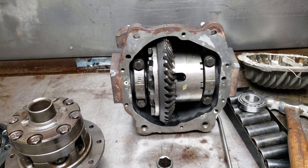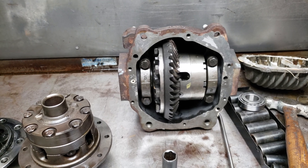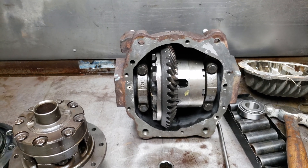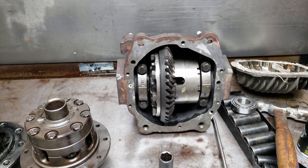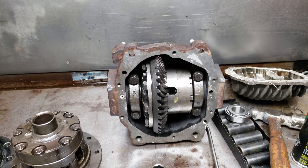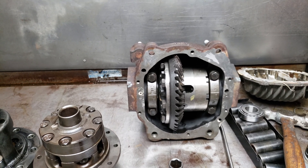It is out of an older Jaguar. When I bought this axle, it had the open diff in it that I just showed you, and I needed the power lock. I'm doing an LS swap Jaguar, so I wanted the power lock pretty badly. And I wanted something a little bit updated, so I started looking at the JKs, and they have an 8.9-inch ring gear from 07 and up, and a bigger pinion that has a much larger pinion shaft in it. But because of that larger pinion shaft, the bearings all change when you go ahead and put it back together.